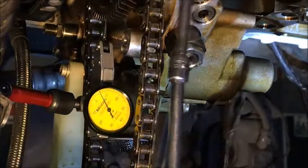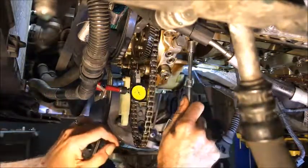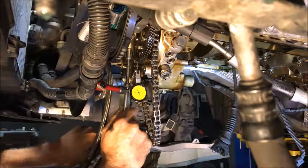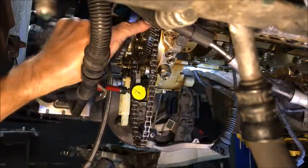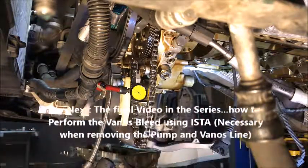We'll check each of the three bolts one more time, then we'll be ready to just button up the rest of this car and get this thing going. This is the last little kind of weird thing that had to be done, so we'll just get them all snugged back up and the rest of it is easy peasy. Let's check it one more time — back on zero and sitting on about six. All you got to do is get one of these little dial indicators with a magnetic base; you can get them off eBay, they're not very expensive at all. That pretty much wraps up our series on how to do rod bearings on an S85 engine. Thanks for watching.